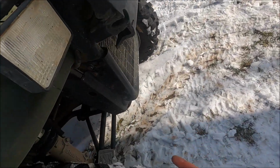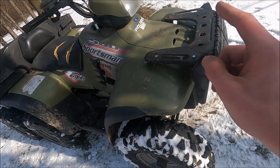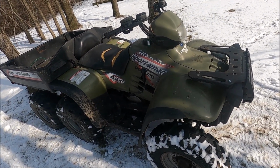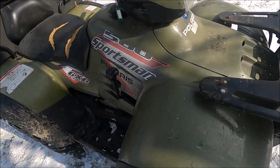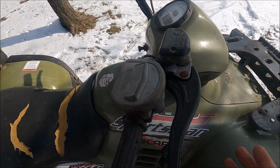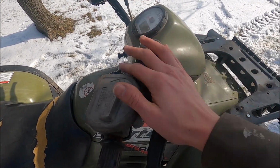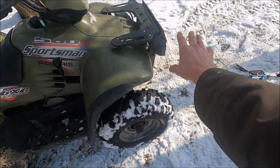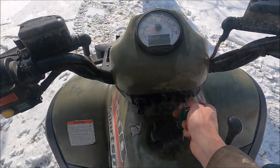And I got to put a couple more bolts in the front differential. And we'll probably work on the, whatchamacallit, the brake fluid. I'm pretty sure, I know it's the front brakes. I don't know if I have to rebuild the calipers because I think it's just out of fluid. So we got to pop this up. We're gonna put some fluid in the system, bleed it, but first, let's get all this together and looking better than what it is.